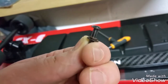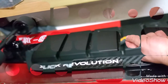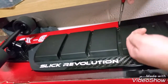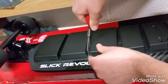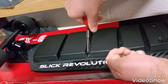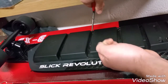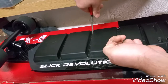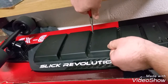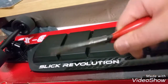I found it a little bit easier to use needle nose pliers to take out the bolts — my fingers are quite fat so I couldn't get between the segments of the battery to get them out. One thing I noticed is that the flat washer sits quite tightly between the segments, so make sure you take them all out, because if you start removing the battery with them in you will definitely drop them.